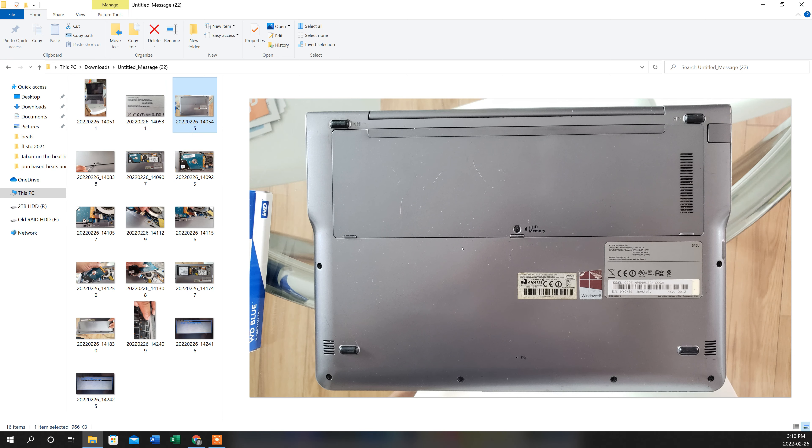If you look at the bottom and flip it upside down on your working table, there is a single screw you have to remove to get to the opening where the hard drive is situated. Normally in most laptops, regardless of brand, you can just lift the panel up with your fingernail or slide it forward towards the rear hinge area.